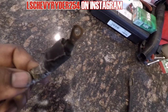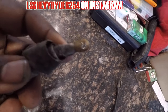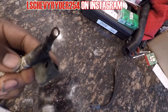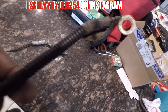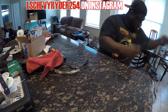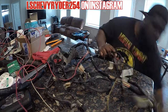Went to the junkyard, got a — we just cut one off another harness that was all jacked up, so I wouldn't have to worry about what size this was and finding the right crimp terminal and all that. Same gauge wire, everything is going to be fine. Same thing with this ground — just splice it into the other connection and we'll be good to go.